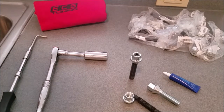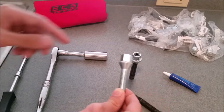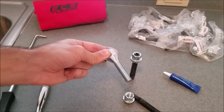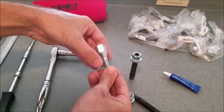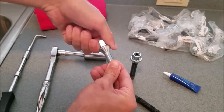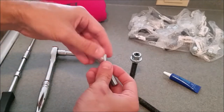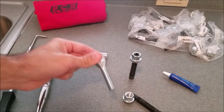First, we'll explain the differences for those who don't know. This is a wheel bolt — it bolts your wheel on by clamping the wheel up against the hub. The problem with a bolt versus a stud is the same reason people upgrade to head studs over head bolts: as you are clamping this in, you are applying a stretching force on the bolt, which is what's clamping it down, but you're also applying a rotational force. So you're putting torque on that bolt — it's being stressed perpendicular to its axis and also along its axis. These are not going to tighten down as nicely, and you're not going to get as consistent a torque across all four bolts, so the wheel might be clamped unevenly.